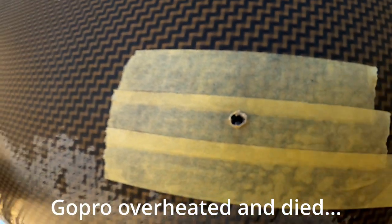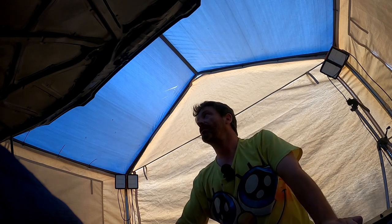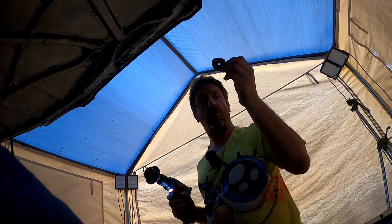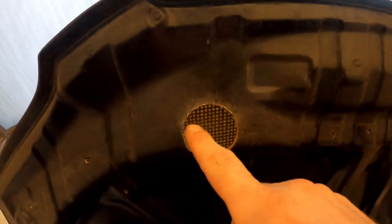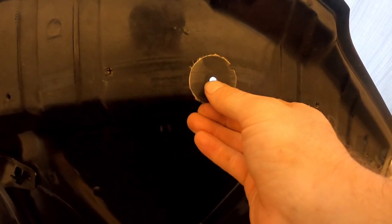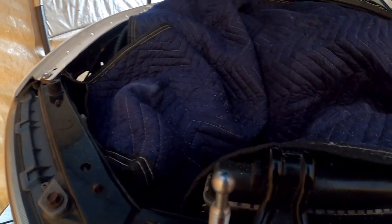It's doing the same thing on the opposite side. At the risk of making them different, do I do this side exactly the same, or do I do it in the correct size? I should probably just do it in the correct size. That's a bigger hole, but hopefully that's big enough to get the socket through, which I actually have to go and buy. Because I cut this one out correctly, I can put this in here — I can see that it perfectly cut out the hole. We have to assume the bonnet is symmetrical, and all we need to do is line this up so it sits nice and just covers the hole, trace that, and that will give us our cut-out area. Made a template. We're protruding up like we should — want the absolute bare minimum. Close the bonnet on that — there's our mark, so we need to drill that out.